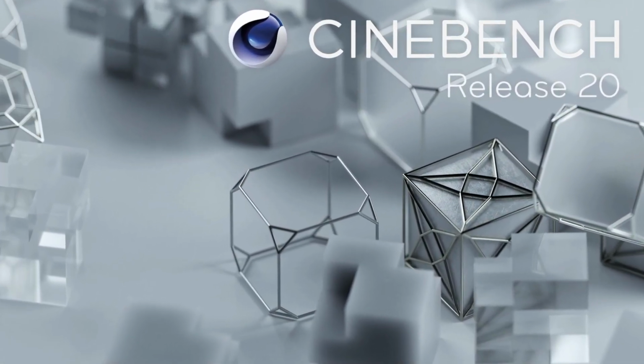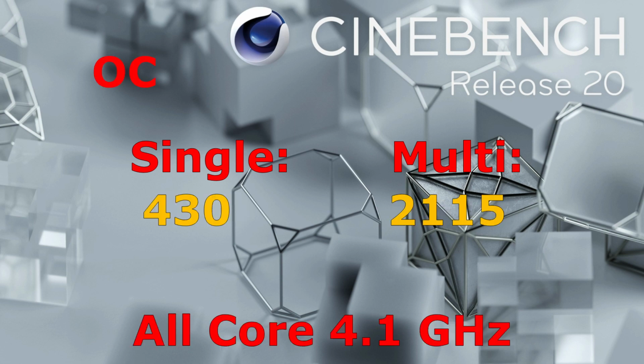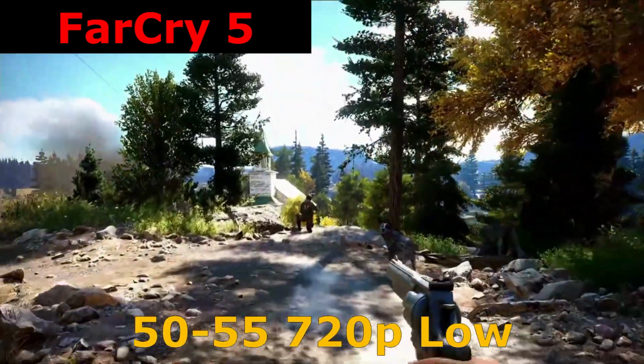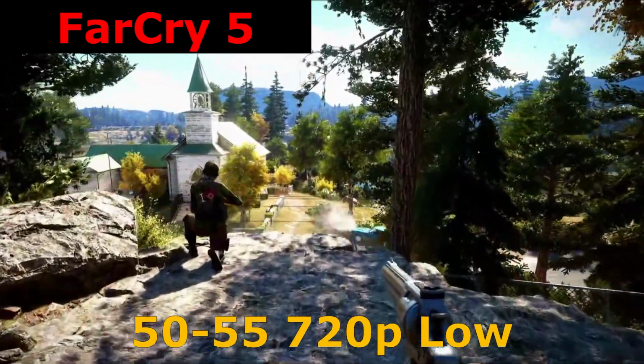Now with Cinebench R20, you wind up with a single core score of 396 and a multi of 1940. But with an overclock, the single goes to 430 and the multi goes to 2115. Now games like Far Cry 5 do see a slight performance boost with an overclock of all cores at 4.1 and the iGPU sitting at 1600.